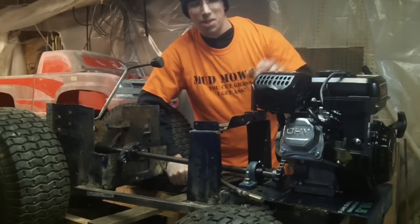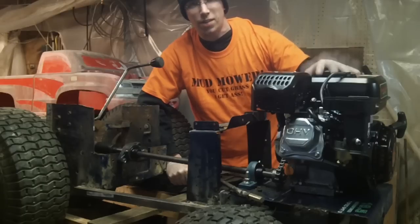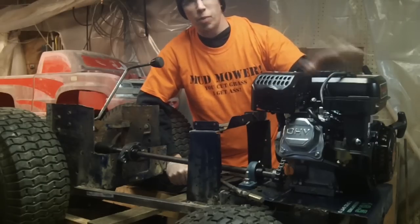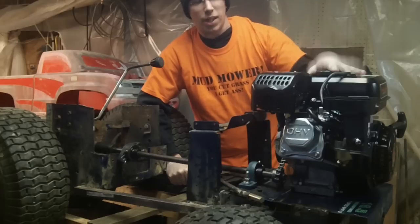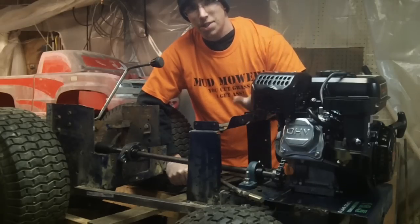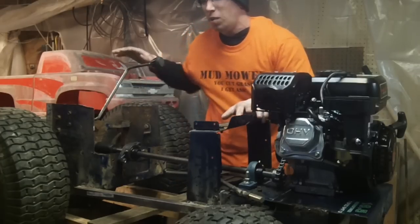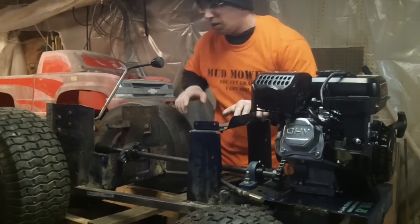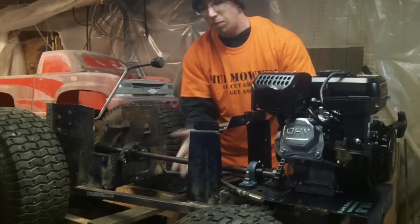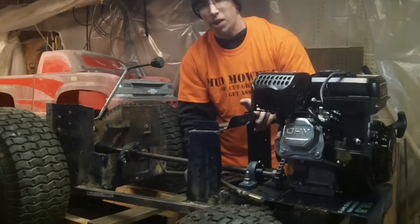All right, here we go — we're going to see whether the clutch assembly works. We've got it bolted in, the gas tank put back on top, exhaust for now. Keep in mind the exhaust is going to get rerouted and the gas tank is going to go up underneath the windshield. This is just a test run to see whether the clutch will engage the driveshaft and from there be able to engage the rear. Right now we're in neutral, so we're going to get the engine kicked over, make sure the driveshaft actually turns, and from there we'll drop her in gear.